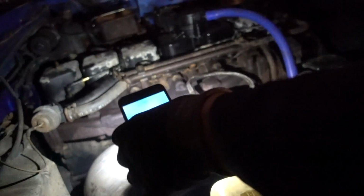Is that oil coming out of the feed right there? That's pre-lube oil. Oh, pre-lube. Pre-lubed her. Well, the turbo oil drain is now leaking. We can fix that. Was that a gasket that I had? Yeah. Normal one? Yeah, that's all.